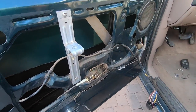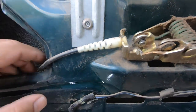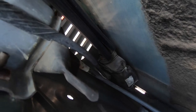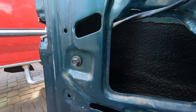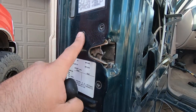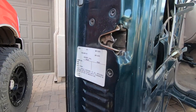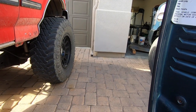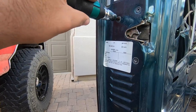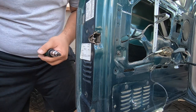We've got the door panel off again. The cable broke right there — the other end should have gone in there and it's just completely broken. You can actually change this thing with the mechanism still in there, but it's a lot easier removing it to get closer access. That's where this little impact tool comes into play, because these screws are soft and you want a tool that fits snugly — the PH3 screwdriver that came with the kit fits pretty well.